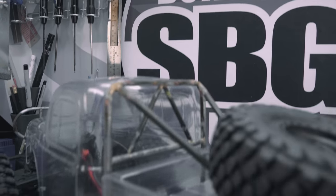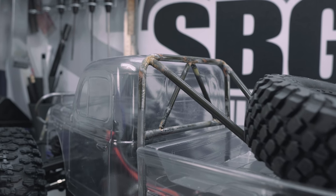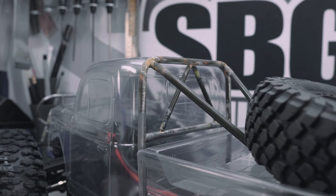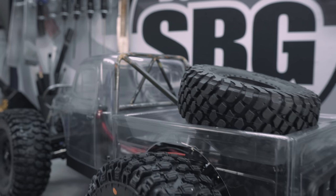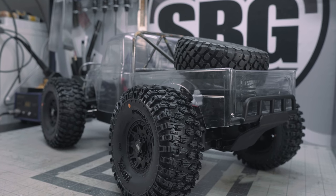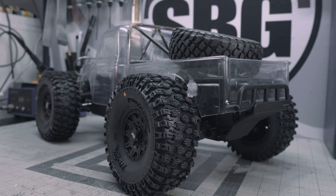I've got a head start on Josh, I do believe, as he had a little vacation. In the time Josh spent to design up that cage, I'm almost done mine. Without any computers, computer-aided design, or even a ruler, I managed to come up with some of this tube work. It will be hard-mounted to the aluminum plate chassis, giving it nice mounting points. I will also mount to the rear shock tower so it's all kind of buttoned up and tidy.